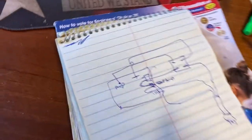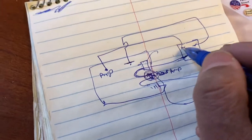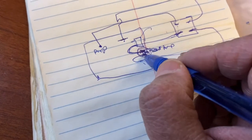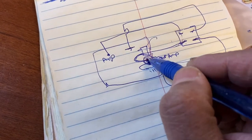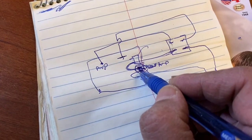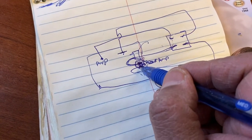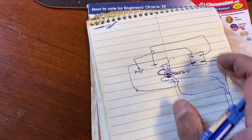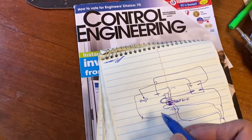First we need to check the circuit breaker, then check the switch. The first test is a continuity test on the circuit breaker to make sure it's closed and not an open circuit. Then measure from the lower terminal before the breaker to the top terminal with the switch on. After that we'll do a quick test to power the machine up, and then troubleshoot the circuit board if needed.